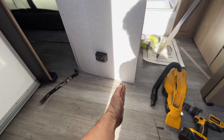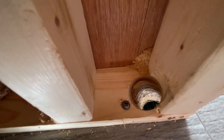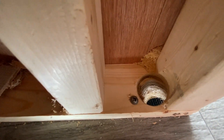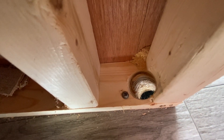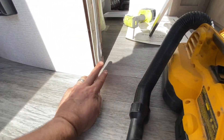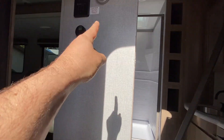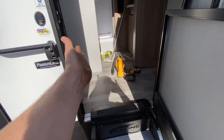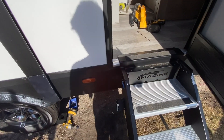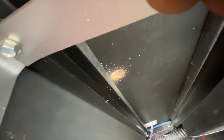There's a black tank right here and it's about right here where it's at, so there's not much room. What I ended up doing was actually drilling at an angle to get a pilot hole for the bigger bit, then made a hole going sideways into the wall, and from there it was a straight shot up - no problem. That was a little tricky but I had to go at an angle to miss the tank. You can definitely see there is not much room for error.